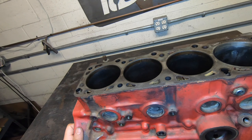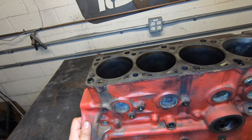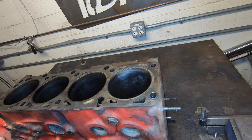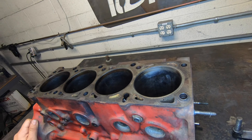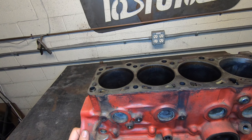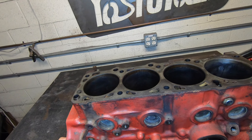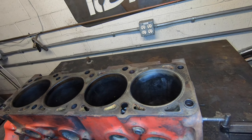That's pretty much all I've got on blocks. The other common thing is squirter block or not squirter block. In my experience I haven't noticed much difference with the squirters or not. I assume it's better to keep oil capacity and not squirt it at the bottom of the pistons if you don't need to. Everything we build has a modern performance piston and just doesn't require the cooling. Some people can't sleep at night unless they have oil squirters — they read it on the internet — so we're happy to set you up with that, but personally it's not my ideal.